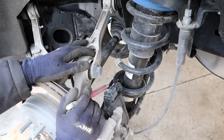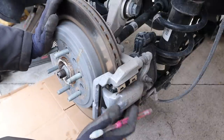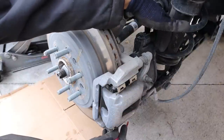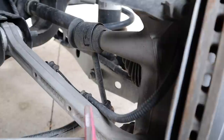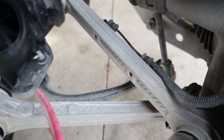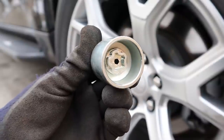Taking a look at the back brakes here, the diameter is almost the same as the front brakes, but we do have a single-piston caliper, which I think is a little small. At the back there's an electronic parking brake — luckily there is a shop mode you can put in on the screen that will allow you to change the brake pads yourself without a scan tool. Interestingly, the knuckle itself has a protrusion that connects to this bushing, which is the sway bar link at the bottom; there's a ball joint, and then that goes to the sway bar which is connected to the frame. This is like one of the most generic wheel locks ever — there's really nothing to it.